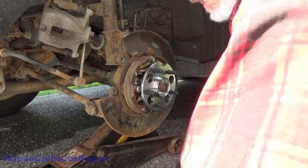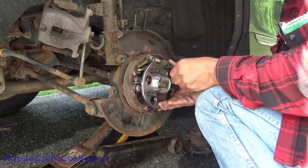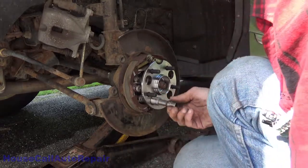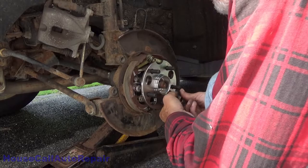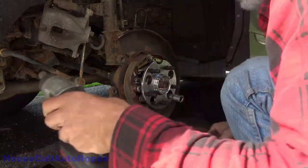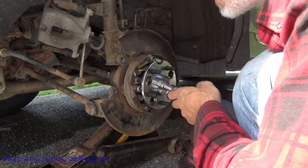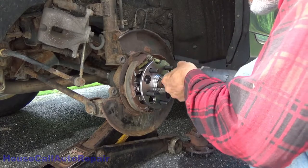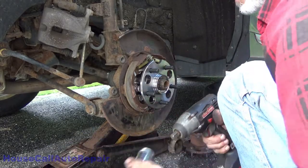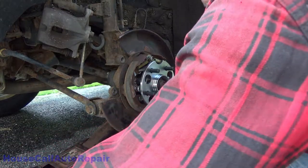Probably all because of the axle not wanting to go. Started. Now I go ahead and get all the other bolts started. Go ahead and spin all of those in. Spin your axle nut on. Not even all the way, just to the edge.